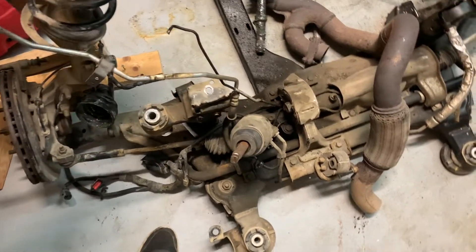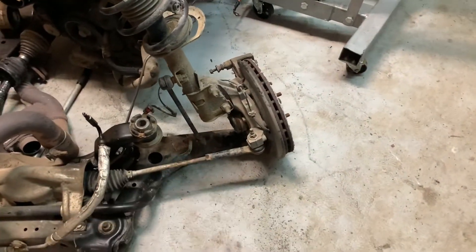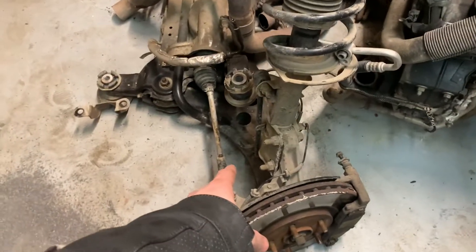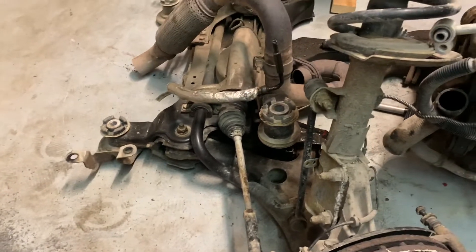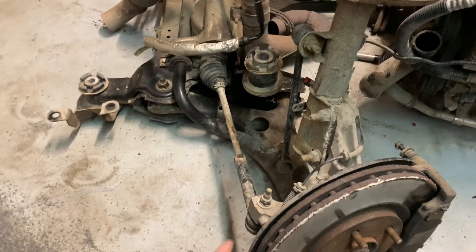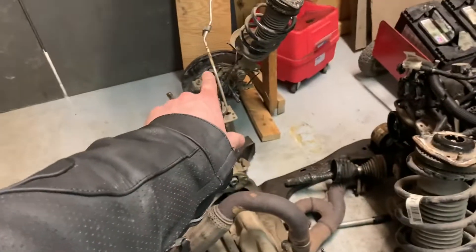The rear motor mount is right here above the rack, so I may have to move the rack either forward or back a little bit, which isn't necessarily a big deal as long as I can keep things straight relative to the floor. Someone else mentioned using a rack situated on the front of the cradle and flipping the shocks around, which would actually work — except my links would probably not line up really well. I'm not majorly concerned about having a sway bar. Basically I'd unbolt the bottom ball joint, take the whole knuckle assembly, move it over, so my steering rod would be on the front of the knuckle and the rack could go across there.